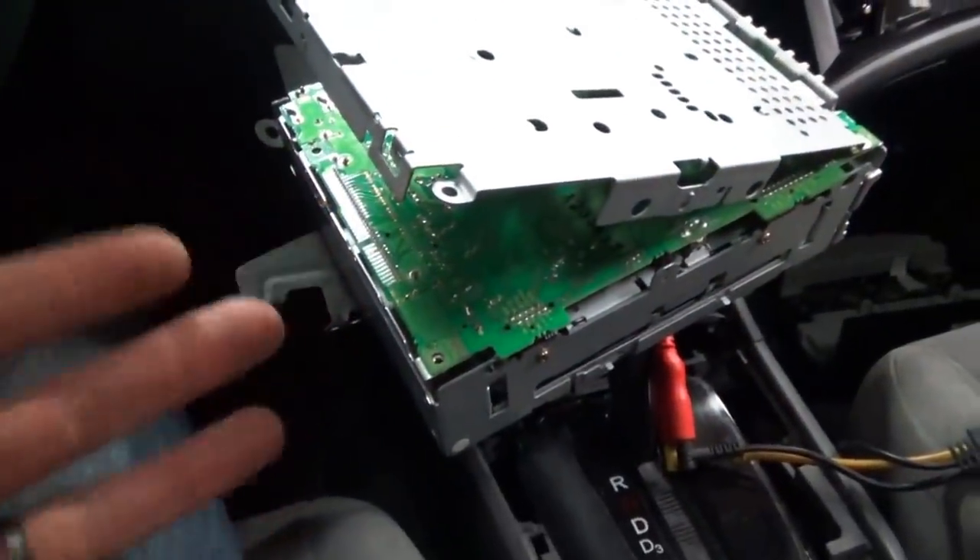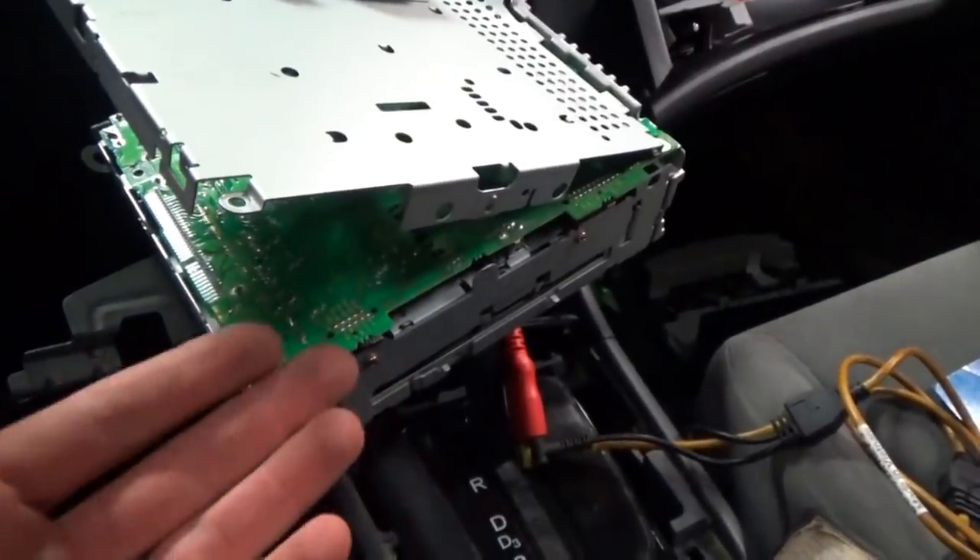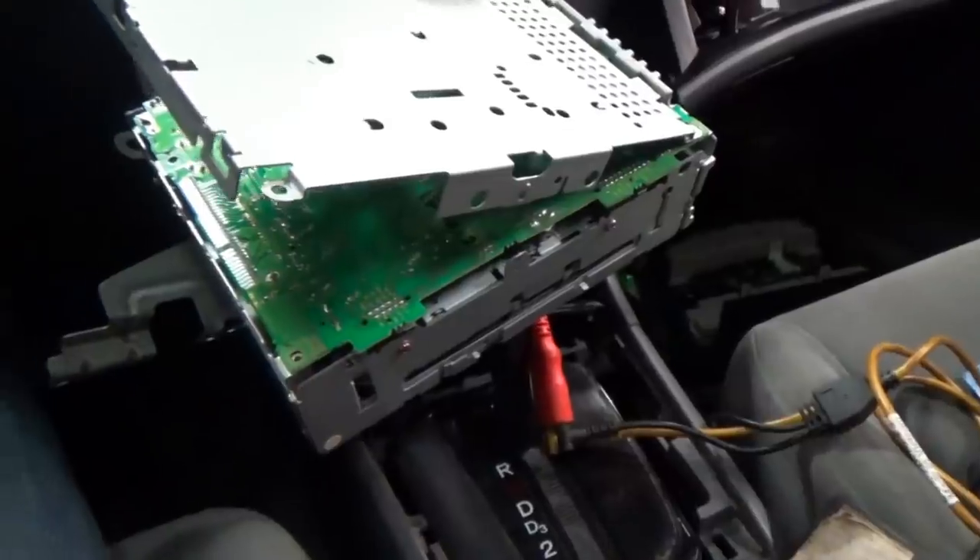I don't really want to rip this apart because that would potentially kill her radio — the radio still works, the CD player and stuff. It's just the illumination. You can't just solder wires and bypass the board because if you solder to the ground pins you'll make all the lights really bright with no dimmer control. You don't want to solder the actual power feed to the 8V feed either because it'll make everything on the HVAC unit bright and you can't control it. We don't know what is on this board that feeds the 8V — that's the part that doesn't work. Honda — why go to this complication? Everyone always just has two wires on the same circuit, nice and easy. Instead they splice everything together, the audio and the HVAC, and go through this voltage converter — unnecessary complication. When it breaks, you've got to buy a whole new piece, and this thing is not cheap. Anyways, that was the diagnosis. Couldn't really do the repair — no parts available, unfortunately.